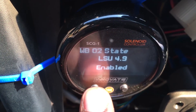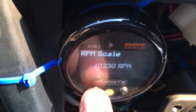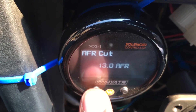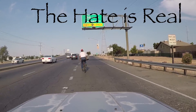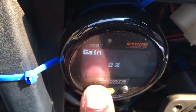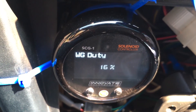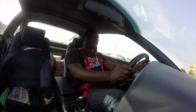You can set a pre-programmed air-fuel ratio limit so that if you exceed that threshold under boost after a certain boost pressure, it'll actually drop the pressure back down to wastegate. That way you don't have any issues with boosting too high for what your fuel system can handle — if the car leans out it'll automatically take it back down to wastegate. Right now I have it set at 10 psi and we'll see how that works.